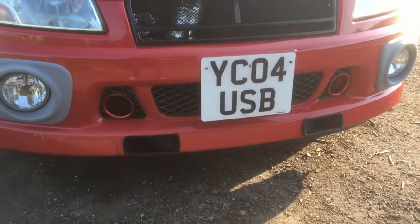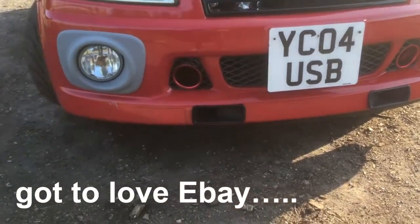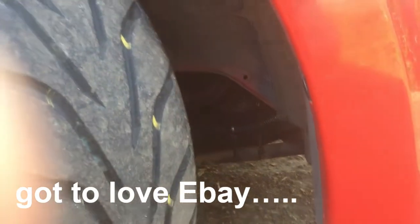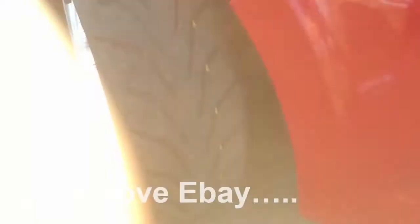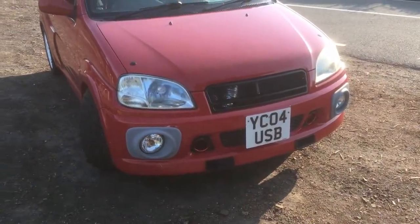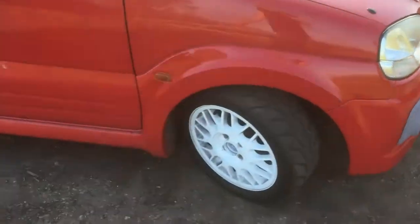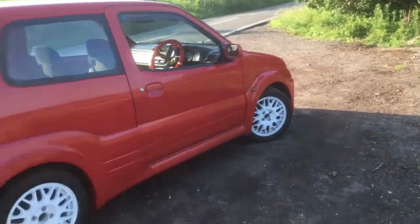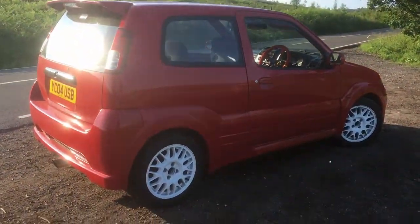I don't know if this is actually going to do anything, but the two ducts at the front — not the red ones but the very bottom ones — are a bit old school. From the front I've run some ducting that runs right to the back of the brake disc; it's about a three-inch pipe, so I think at speed it's going to put quite a bit of air in there. I removed the back of the dust cover on the discs just to let all the air in. It cost me something like 20 quid — eBay specials.